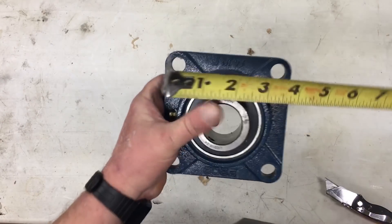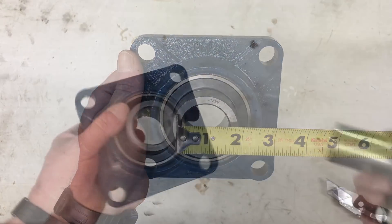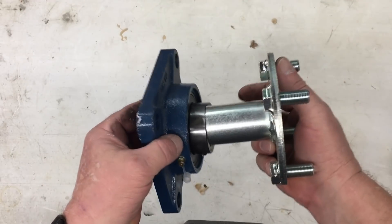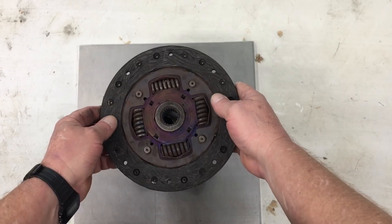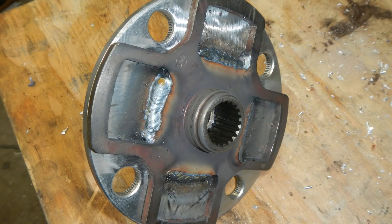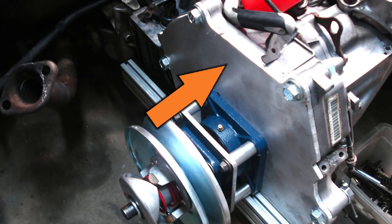This next item is actually left over from my last build. It's a fairly big flange bearing — it measures about 5 inches square, and the inside diameter of the bearing is for a 1.5-inch shaft. This bearing is going to be combined with the go-kart axle flange that we previously unpacked. We'll need to knock out the wheel studs because they'll just get in the way. The axle flange will slide right into the bearing once we clean off the tin plating. Now this clutch disc is also left over from the last build. The idea is to harvest the splined hub from the clutch disc and weld it onto the go-kart axle flange. This thing is what connects our go-kart engine and torque converter stuff to the input shaft of the Honda transmission. If you can't visualize how this all goes together, don't worry — we'll cover it when we do the actual build.